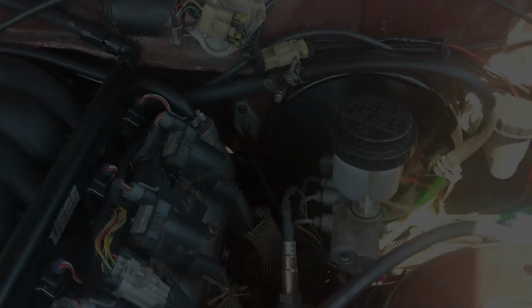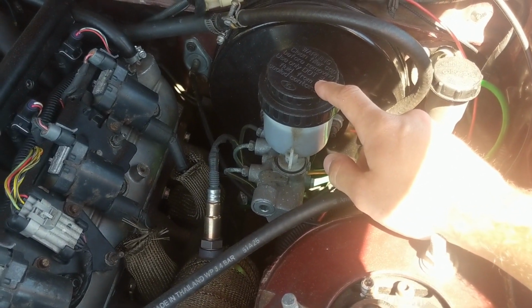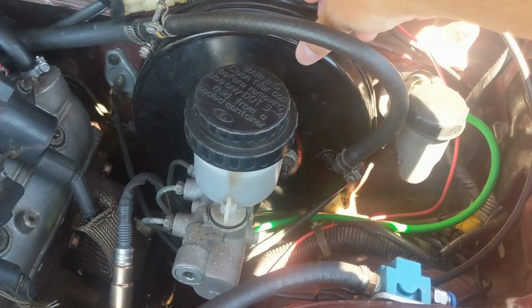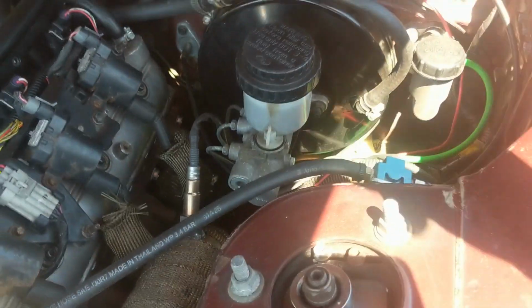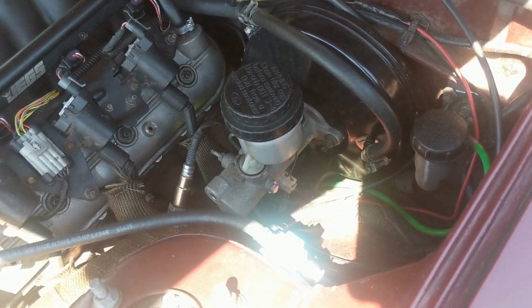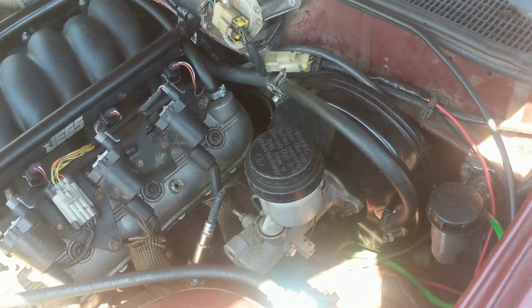Brake setup, I'll move on to the brakes. So this is a Z32 brake master cylinder. It's 1 1/16 inch. This is an S14 manual transmission brake booster. It's slimmer, so it allowed me to suck the master cylinder in some. The stock one is really fat, and I don't have any complaints with this one. Sometimes after a huge boost hit, when you're coming off boost and you start to brake, it's a little firm because it doesn't have a lot of vacuum.